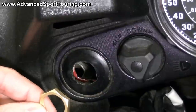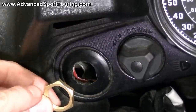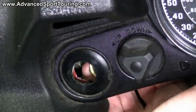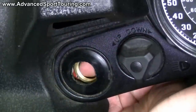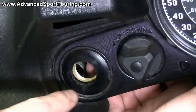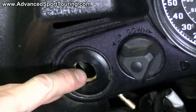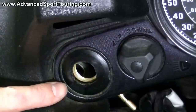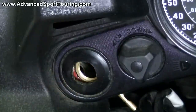Once the ring fits in there, it won't move — that way, when we're putting our outlet through and turning it, this will stay put and clamp everything towards each other. When you have enough metal removed, it'll fit in just like so. Take off the metal really slowly, a little bit at a time. You might take a little bit of the plastic off too, but the outlet covers it, it's not a big deal. Just take your time and eventually it'll fit into place.